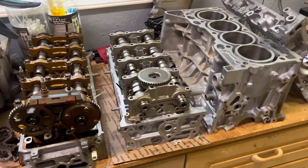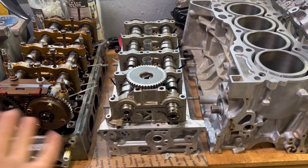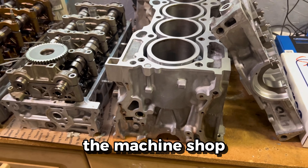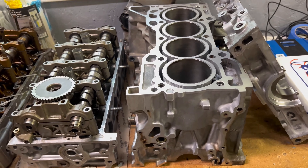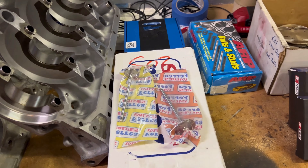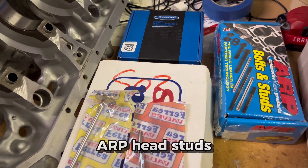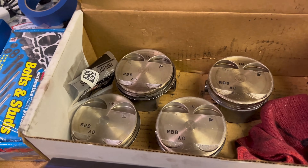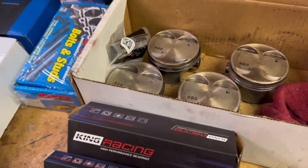Here are our major motor pieces. This is the original head that we're not going to be using; this is the new one — it'll perform better across the board. This is the original block. Everything's been to the machine shop — it's been cleaned, bored, and decked, and it is ready to be put back together. Here's the head package I'm going to be running in the K24: Ferrea intake and exhaust valves, Super Tech dual valve springs, and ARP head studs. For the bottom end we're doing a basic refresh using King Racing bearings and going to the TSX-style piston — a little better than what was in there — while still using the factory connecting rods and crankshaft.